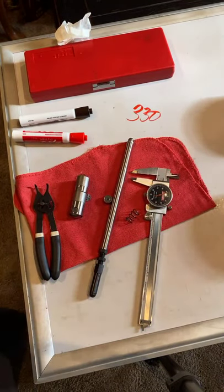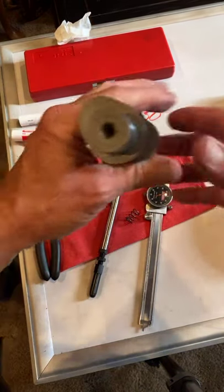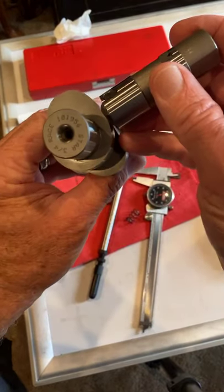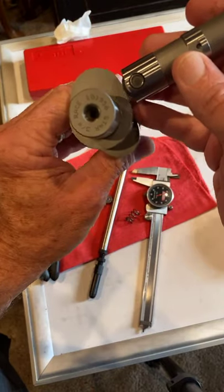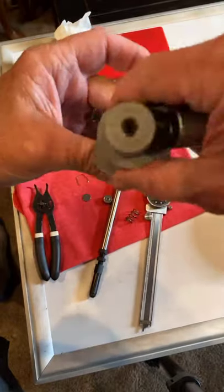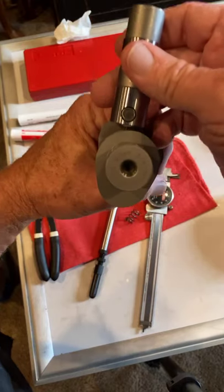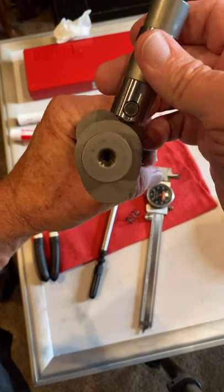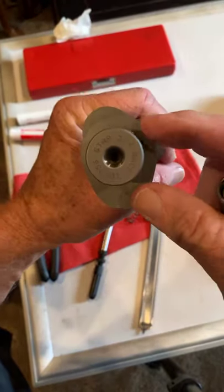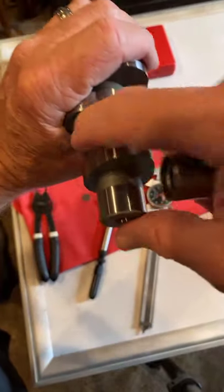And I have so much more left to tell you. I want to tell you about, while you're adjusting that, looking at this 3/4 cam, you can't adjust this lifter when it's here. Can't adjust it when it's here. You have to have the camshaft on the heel. You have to have the camshaft on the base circle. It has to be between here and here in order for you to set the lash. It has to be on this base circle, on the intake lobe and on the exhaust lobe.